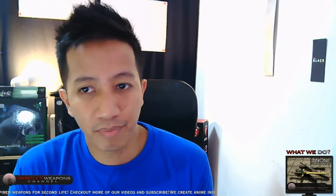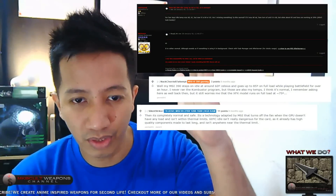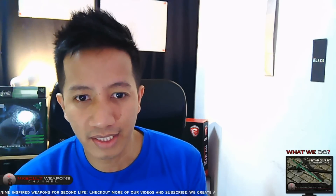What I really want you guys to know before you purchase this GPU is that you might want to consider your chassis, because this card draws a lot of power and heats up quite a bit — it heats up even more if you're using the MSI Gaming App, the one with OC mode, gaming mode, and silent mode. How did I find that out? My idle temps were running around 60 to 65 degrees Celsius. Most R9 390 owners on forums will tell you that's normal, but for me it didn't feel normal, so I did more research to find out what was causing it.